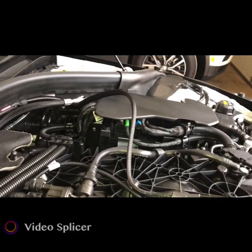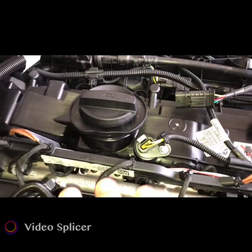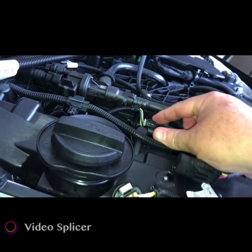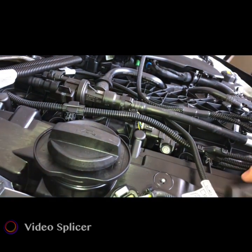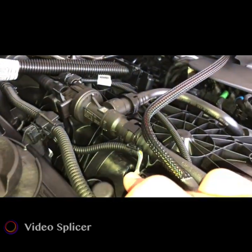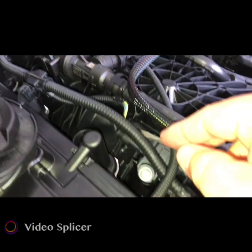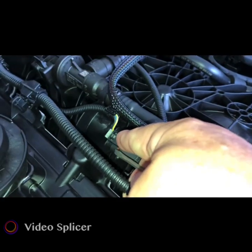Okay, with this cable ran, you see these right here. You see the oil fill area. We want to get to that connector. It's right there. So let me get that unclipped, and you'll clip these in there, and I'll show you here in a second. Okay. I've already popped the connector a little bit, but basically what you can do is just pull it out with this tab right there with your finger, and you just run this screwdriver up underneath here and just get that out of the way and pop this up a little bit, and you can slide this right out. Very simple.